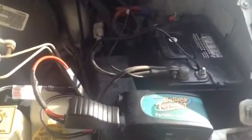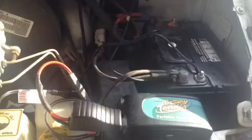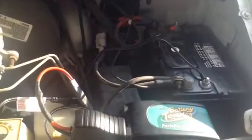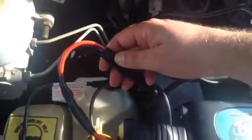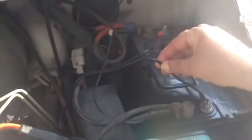With this, it's not one of my problems. I'm just experimenting with getting the cables changed around, because one of the things I find is a bit of a safety issue is the great big alligator clips that come on this stuff. So I've changed it out for these quick detach OEM style plugs. I noticed that the cable here was a 10 gauge, so I bought a 10 gauge cable here. I bought the thickest cable I could find for this end that goes onto the battery.